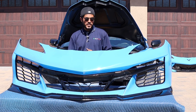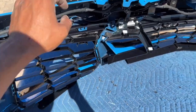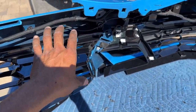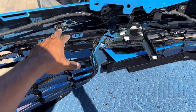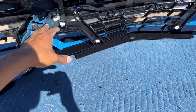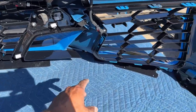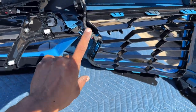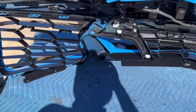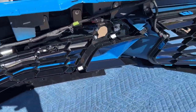From one side, as you go along, take pictures and keep a mental note of exactly where each clip goes and soon enough you'll have the bumper ready to be put back on. Now with the harness all on, even the button to open the front trunk is located in the same general area — pushed up more towards the front of the bumper, just like on the Z06. All the cameras are connected, everything fit perfect, including the ambient air temperature sensor and the other main connector.